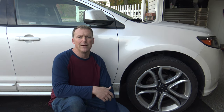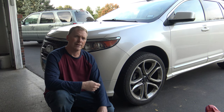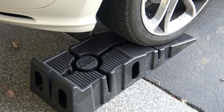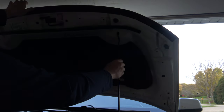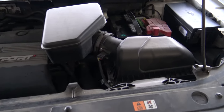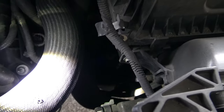We're just going to drain out about four-ish quarts that come out of the pan. I'll have a bucket that tells me exactly how much came out, so I can put that much back in, and then we'll check the level at the end. First thing we need to do is get this vehicle up on some ramps. I've circled the drain plug with a Sharpie marker and I'll show you exactly where it is. To find your transmission fill cap, you're going to be on the driver's side — there's the air box with the air filter.